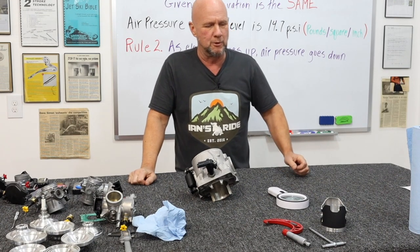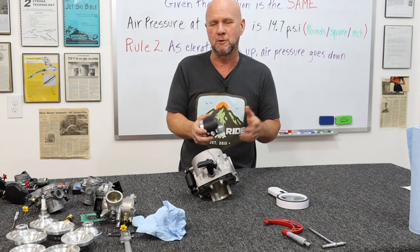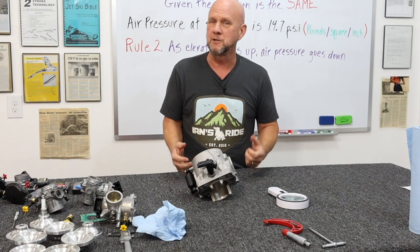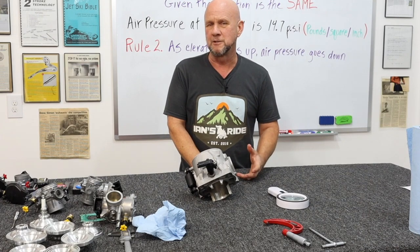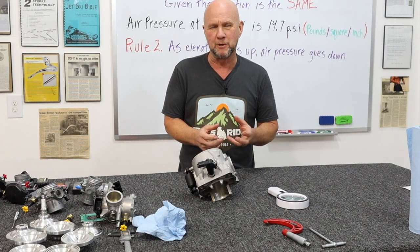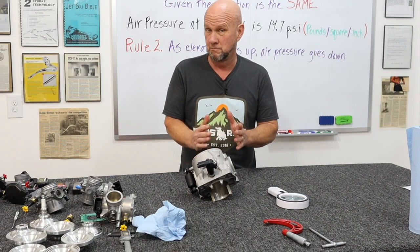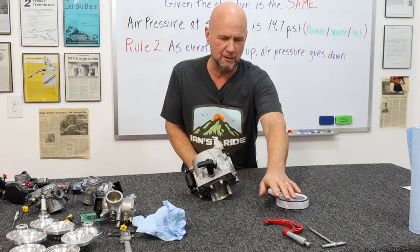Now I'm going to size this Wassener piston to the cylinder. Of course I will cut the bottom to get the clearance so it doesn't touch the crank. But these things really work best at three thousandths clearance. A lot of people would go, oh, that's way too loose — well, it's a different motor than before and they run hot. Just like this guy with it already being hot and adding the compression, that's what stuck it — you saw the heat seizure there. Three thousandths really works well. And then after we remap the ECU, you can easily add some more oil to it, and then you're using that bigger filter. Everybody's running those things at 40 to 50 to 1 and going, this thing is really stunning. Let the extra oil be the cushion between the piston and the cylinder, maybe with some slightly extra clearance — it's a nice free-revving thing that you don't have to worry near as much about sticking.